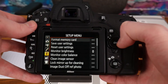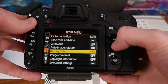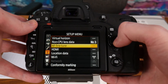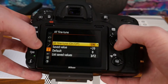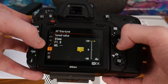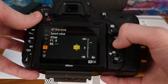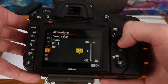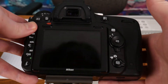Now that we know the camera is front focusing, we want to go to the setup menu. This is for Nikon — I'm sure there's a way to do it for Canon — and this is only an issue with DSLRs, as the autofocus sensors aren't in the same place as the actual camera sensor. On my D750, go to the third menu — there's Autofocus Fine-Tune. Going in there, you can see it's on and it has a saved value for this lens. I had to move it back to +20 because of how far forward my camera was front focusing. Make small adjustments, take another photo, see how it works, and once you have it dialed in, hit OK — it will save and you're done.